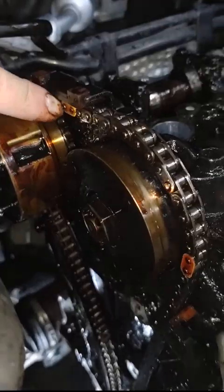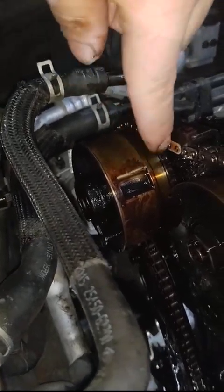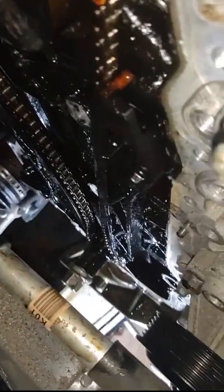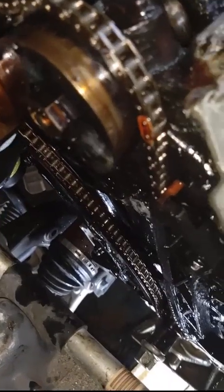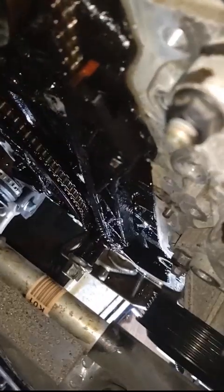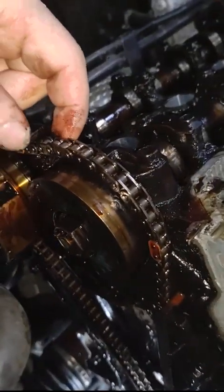When this side is tight, that side is loose, and vice versa. It seems like either the chain is slacked or this particular tensioner is stuck in a negative way, creating this slack depending on where the chain is. It's almost like it's not in bad shape visually, but the chain is stretched to some degree and the tensioner is definitely shot. The other parts aren't that expensive - it's just better to do it all.